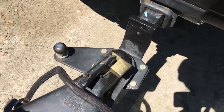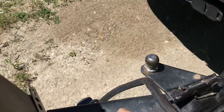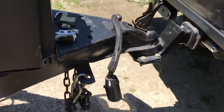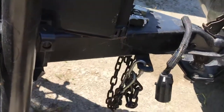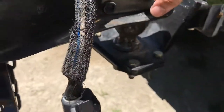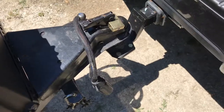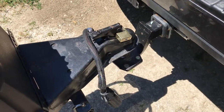We're almost clear of the truck. Take this and unlock this little guy, which helps keep that locked. Lift up on that latch and then crank this up the rest of the way. Once you have it off, you go into the normal setup. I like to store the lock so I don't lose it — once I've got it unhooked, I'll put the lock right back in there. It serves a double purpose: it makes it a little harder to make off with the trailer, and it also keeps track of the lock so it doesn't go anywhere.